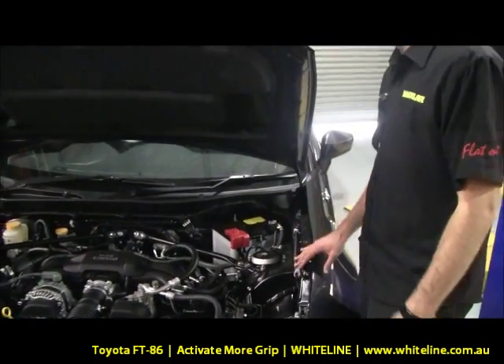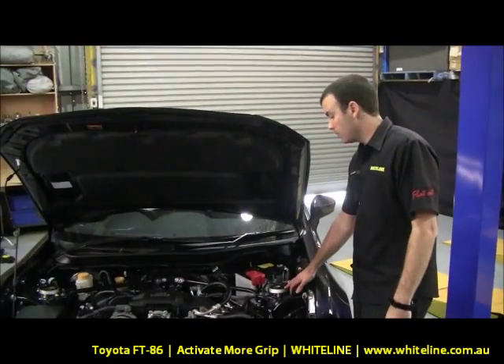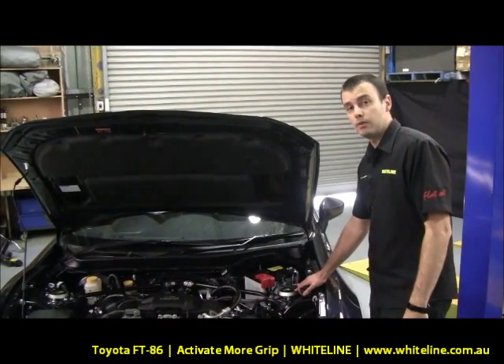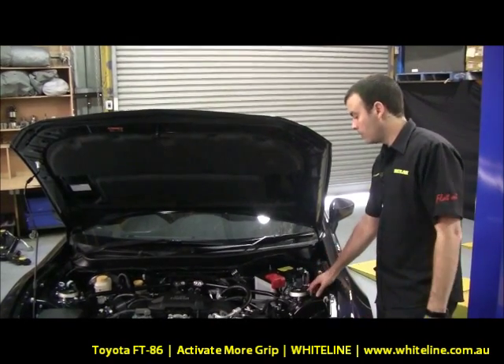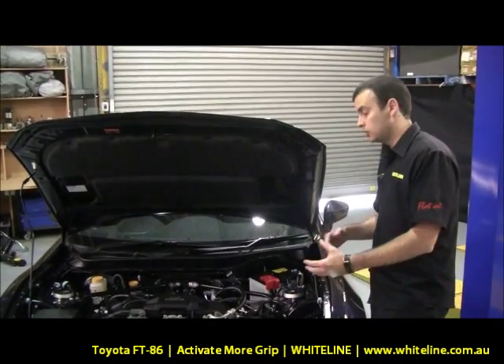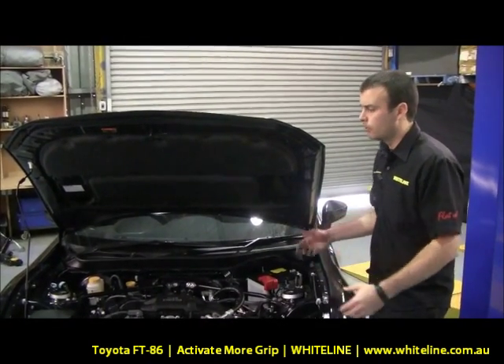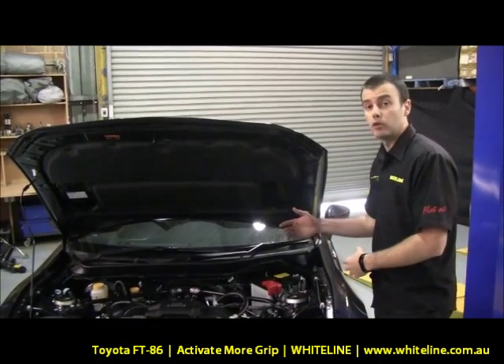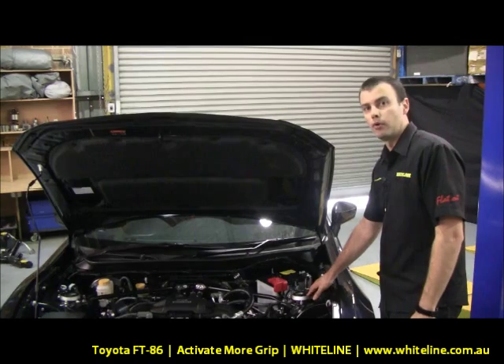The car is a lot more responsive at the limit in the corner. These mounts actually offer about a degree of adjustment — about a degree of negative camber. And when you combine that with the camber bolts at the foot of the strut, you can dial in less or more camber depending on how you're driving. If it's a daily driver, you probably want to pull it back a little bit. But if you're really looking to get as much negative camber as you want, you can get that adjustment through the camber bolt at the bottom.